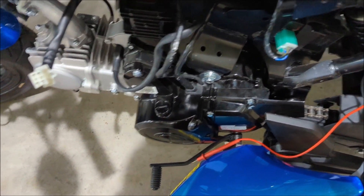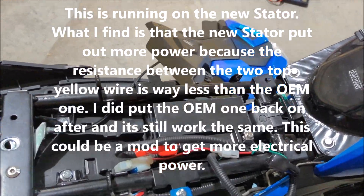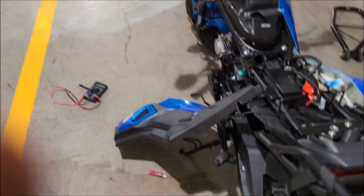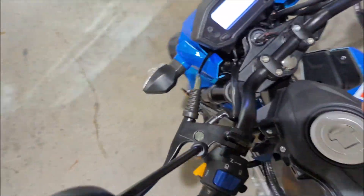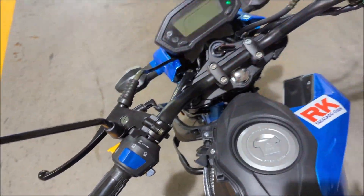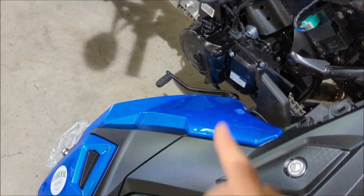The new stator is fine, but the connector was bent. The bike is running now — I disconnected the battery so it's running off the alternator I just put in. When the lights are flickering like that, you know it's running off the alternator because the alternator output is not very stable on its own. So boom — it was the voltage regulator connector all along.